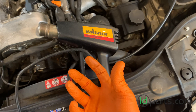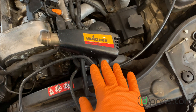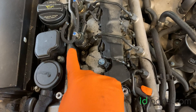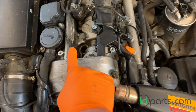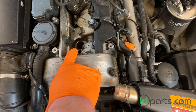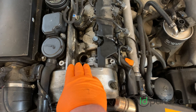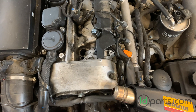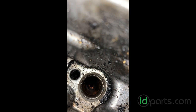I found that removing injectors was a lot easier on a hot engine. Part of that is metal expansion, and part of it is that the black death epoxy softens up when hot. Heating up the injector and the area around it will make this job a lot easier. Use a heat gun, not an acetylene torch, because a torch may melt fuel lines and plastics. A heat gun used properly won't do that. Try to get the injector to about 180–200 degrees — that's around operating temperature for this engine, so nothing in the engine bay will be damaged. Once heated, the injector will pop out much easier.